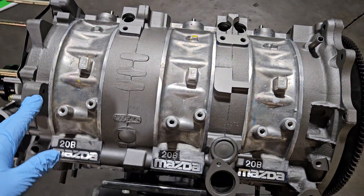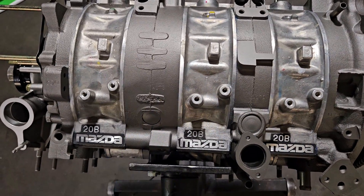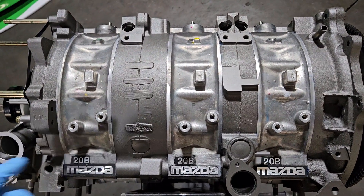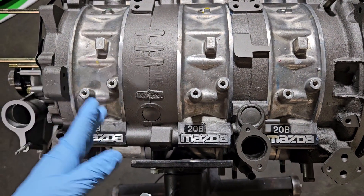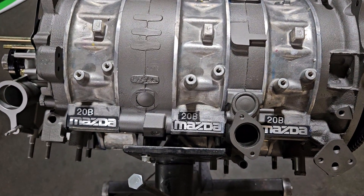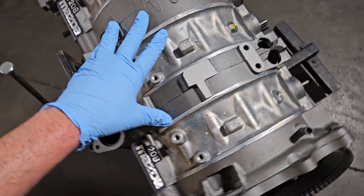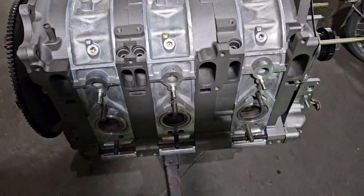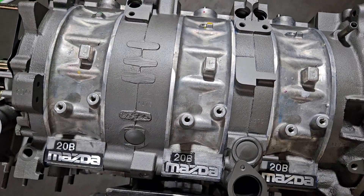As I talk about a lot on this channel, when it comes to bearings, side seal tolerances, and balancing, we opt for Mazda speed specs. We still consider those an OEM spec as they reside within the OEM tolerances — just a narrower window in regards to what's allowable on the assembly and wearable side, so we keep things a little tighter according to the book. Overall, just a really clean build. The fact that these motors are now 20-plus years old, it's always nice to see a really good example of a 20B — and it gave us the opportunity to talk about some of the components and the overlap of generations.